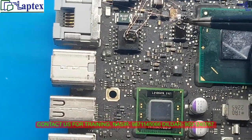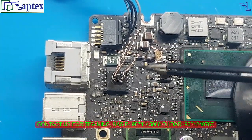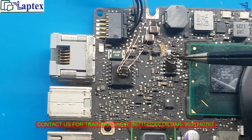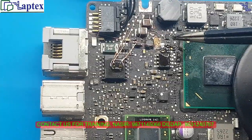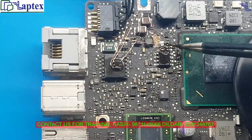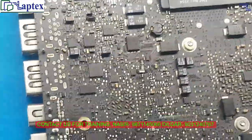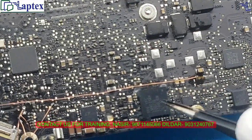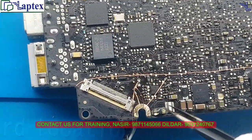You do not have to connect it if it is not cut off, but if there is a short circuit in this place, there is a high chance that your LPC area will not function and you will find that your RAM is not detecting. There are four LPC address lines and they are all located here. If any of the tracks are cut off, you will have to manage it by placing a jumper wire, just as I have placed it from here. This is the communication between the PCH and SMC chip.